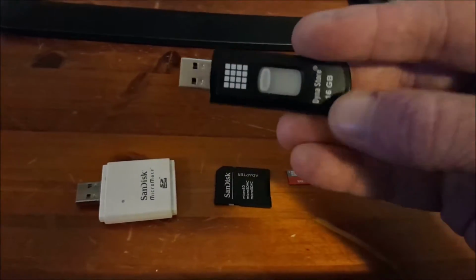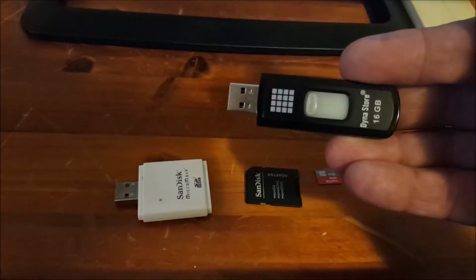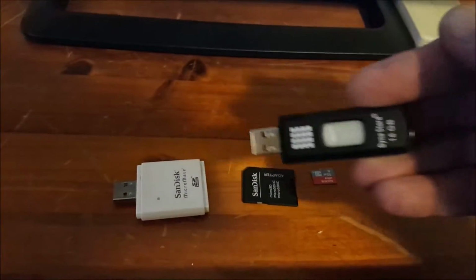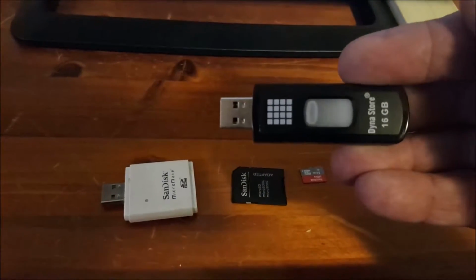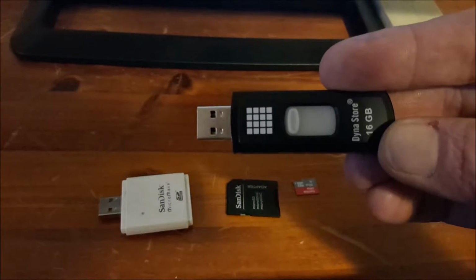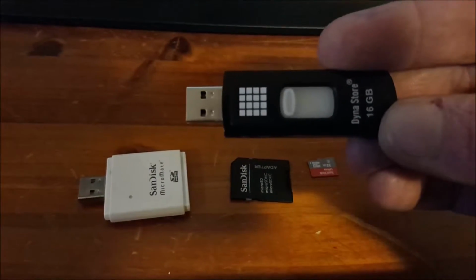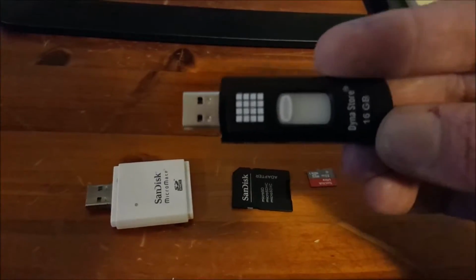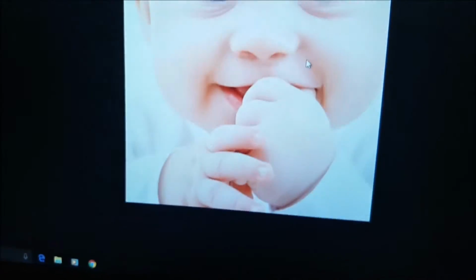memory stick. Now, this one's a 16. Again, you can do a 32 gig. But if you want any of these things to register in your head unit, you have to format them to a format that's called FAT32. So I've already been through this. NTFS doesn't work. EXFAT doesn't work. FAT32 does. So basically what you do is, I'm going to get this unit and plug it into the USB port on the computer,